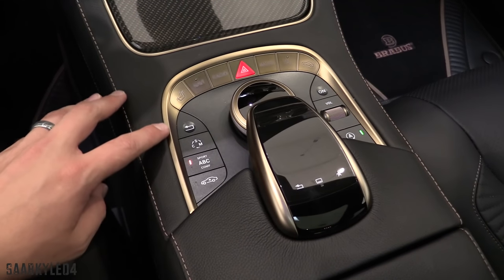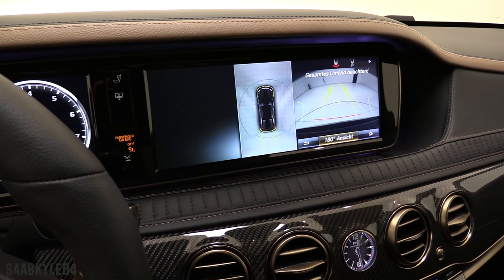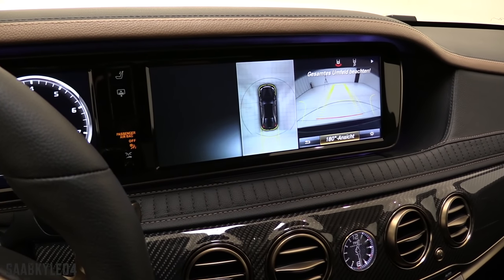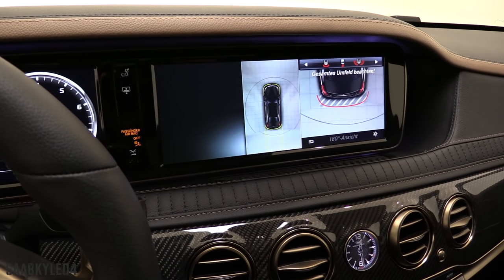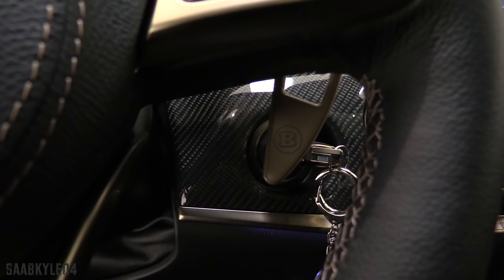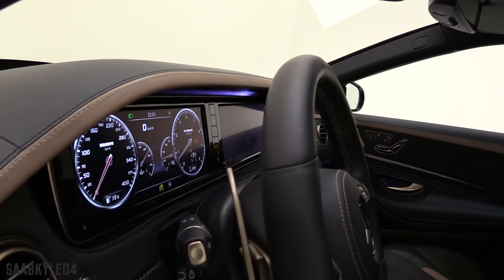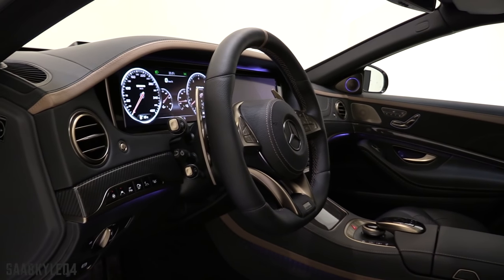Sport mode raises the shift points and decreases shifting times by 30%. Shift times in both sport and manual occur in just 100 milliseconds, accompanied by rev matching downshifts, with manual mode allowing you to shift by the aluminum paddles and maintain the selected gear at full throttle all the way to red line. The big, aggressive-looking hollow paddles are also unique to the BRABUS model.